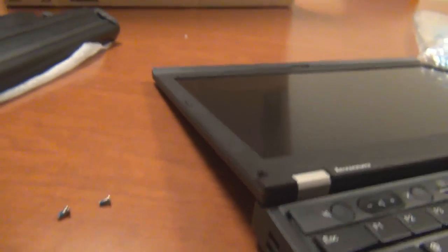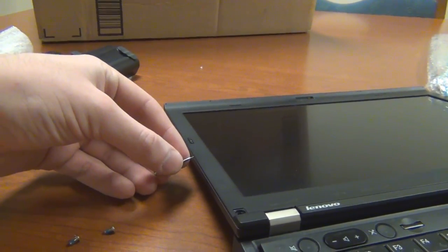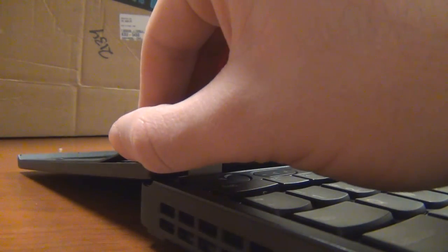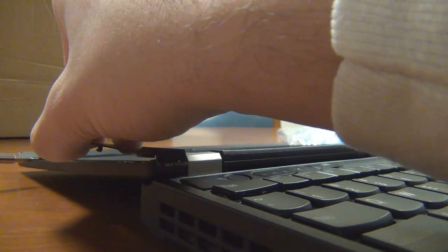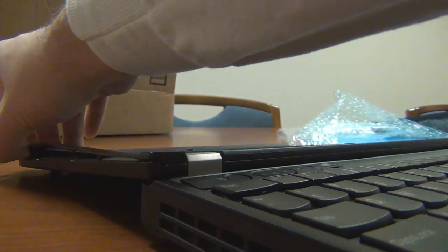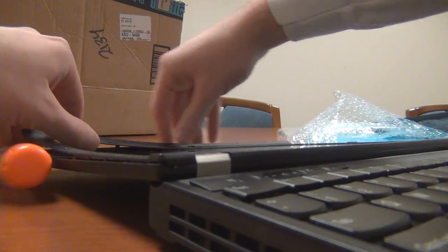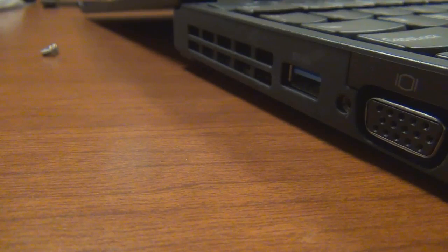The rest of this bezel is all snapped into place, so you're just going to have to find something thin — preferably plastic — that you can slide underneath the bezel to pry it out. Right here would probably be a good place to start since we have a little opening already. Just reach under there where all the snaps are. Be careful — you don't want to break any of the snaps. There's a little bit of adhesive that you have to get off. And there we go — the bezel is off. There are screws here, here, here, and here. I'm going to take those out.